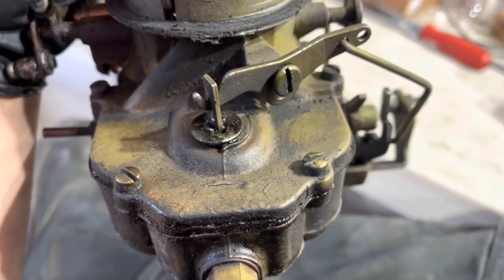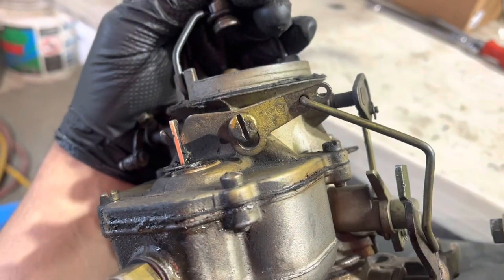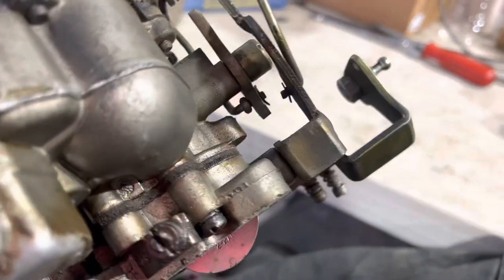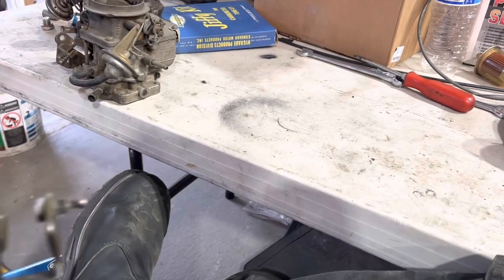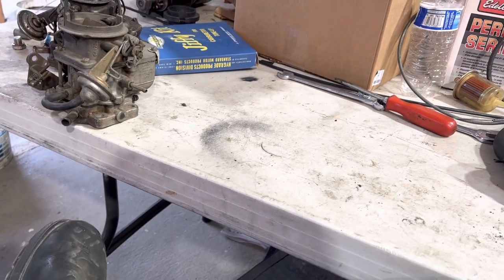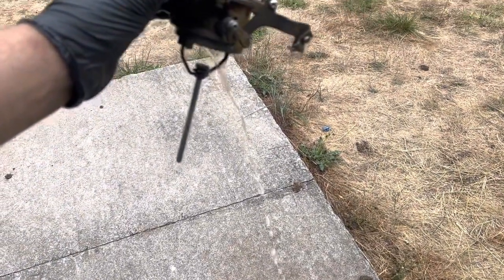The accelerator pump, which also leaks, lives in there. Here's the arm for it — one flathead screw and one clip down here pops the linkage off. I'm covering myself with gas. Did I mention drain it first? Drain it first. So much for those pants.